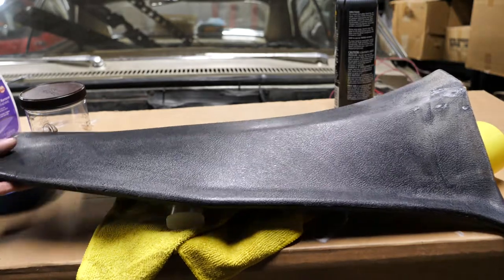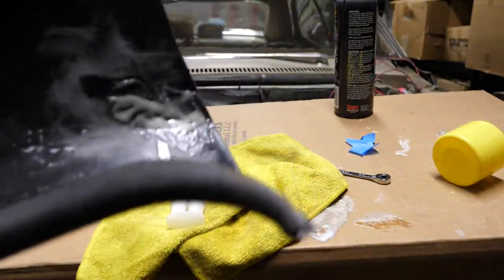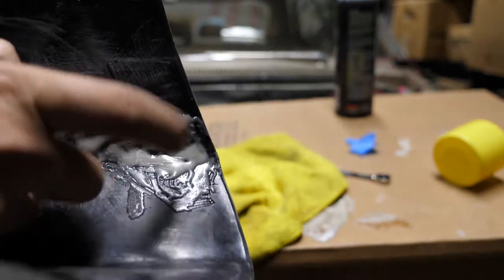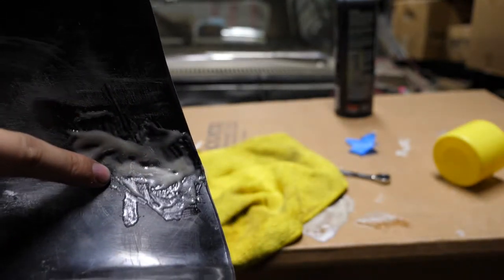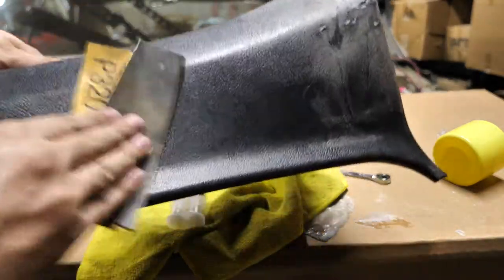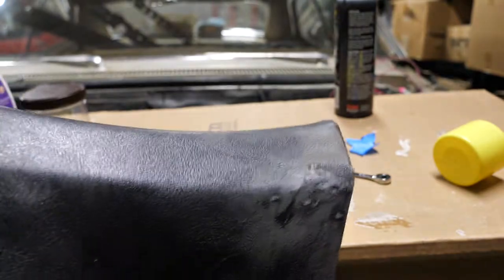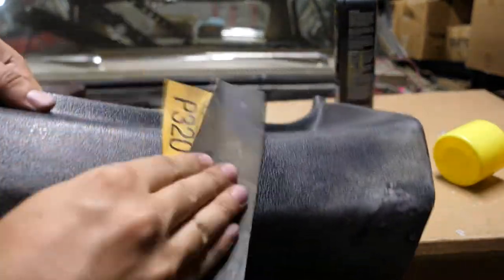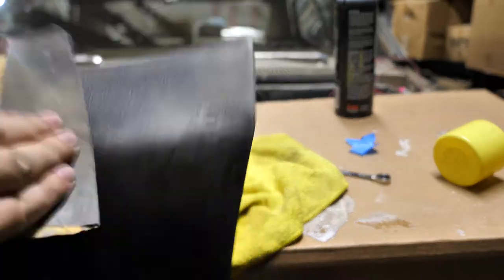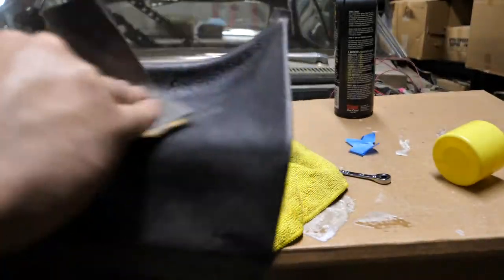It's been 24 hours. I took off the masking tape, and as you can see, now that it's dried, it is hard as plastic, so this side is good to go. I'm going to grab some 320 grit sandpaper and go along this entire trim piece, making sure the entire surface is smooth. For anyone out there doing this themselves, I would recommend that you take as much time as needed to make sure that the final product comes out smooth.